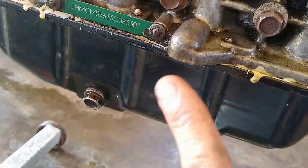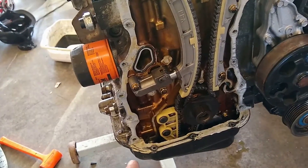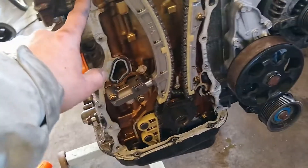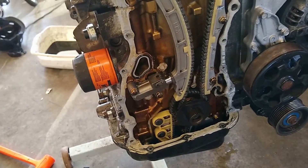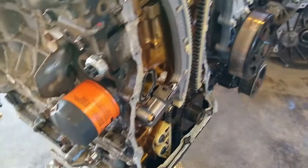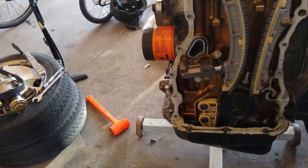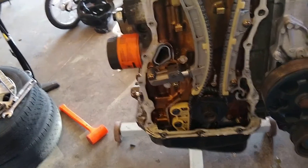One thing I want to mention: I've got an oil leak at the oil pan. I used this MotoSeal stuff instead of ultra gray, and this stuff doesn't work very well at all — I wouldn't recommend using MotoSeal for this. It's okay on the timing cover because it's two machined surfaces like a motorcycle crankcase, but if you've got any inconsistencies in your oil pan rail it's not going to seal well. Hopefully I can fix the oil leaks, get the cam and crank wheels modified, and get this thing put back together.